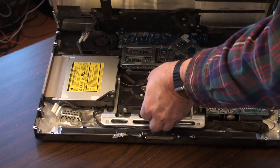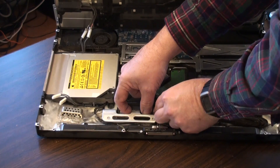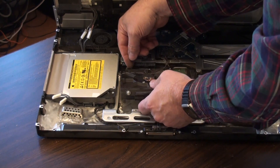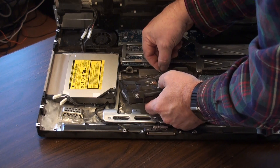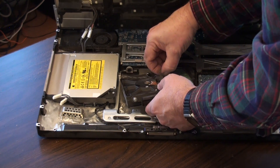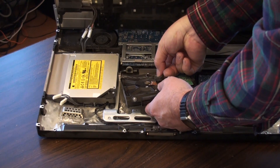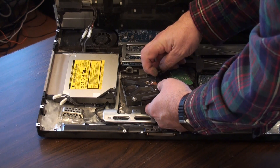Here is the hard drive that we are going to remove. That comes out. Looks like we have more things taped. Oh, this is a sensor for the temperature. I should take that off — there we go — because we're going to put that on the new one.